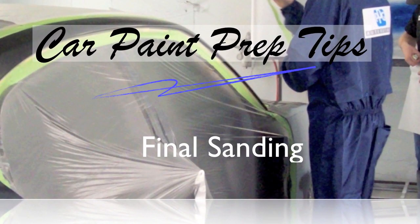Once you've blocked, you're going to start final sanding. Final sanding is the last step as far as sanding. Depending on whether the entire area is going to be painted or just clear coated, that determines the grit. If you're painting an entire car, sand the entire car with 400 to 600 grit. Make sure to get the edges and hard-to-reach areas — use a red scuff pad for those. If you're doing a blend job or clear coating a couple of panels, prep the paint area with 500 grit and use 800 to 1200 grit where only clear coat is going to be applied. Make sure all edges are sanded, be careful not to sand through, and don't use a red scuff pad where only clear coat will be applied — use a gray scuff pad instead.